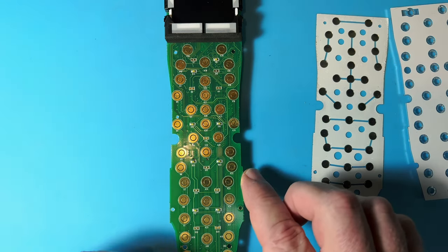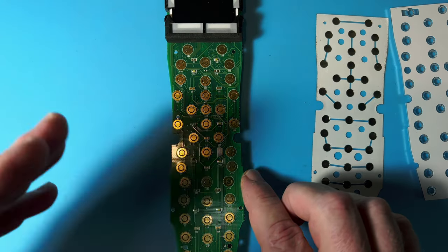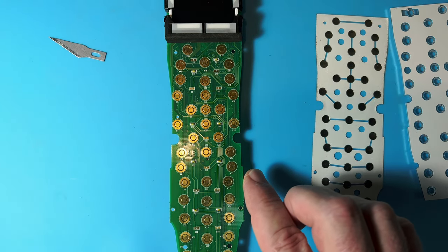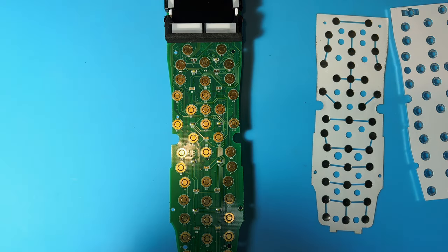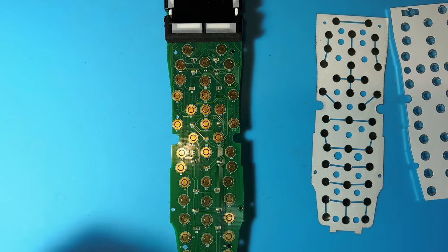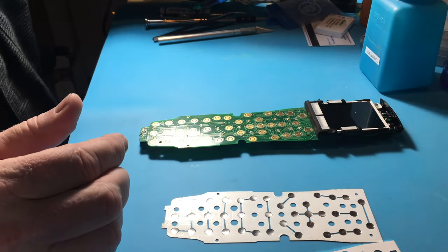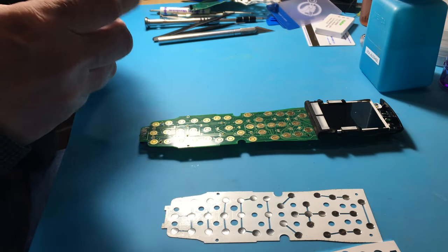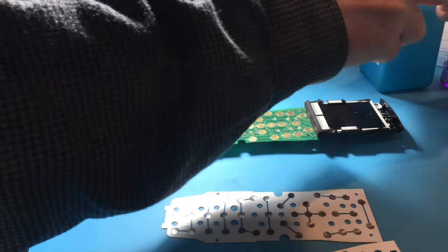So, the repair: clean this with alcohol, and then use DeoxIT on it, which is a lubricant made just for this, DeoxIT Gold. They call it that because it's priced like gold. So we're going to do the same thing here and see if we can make these look a little better. I have, as I said, 99% alcohol here, and I have these Kimtech lint-free paper wipes.